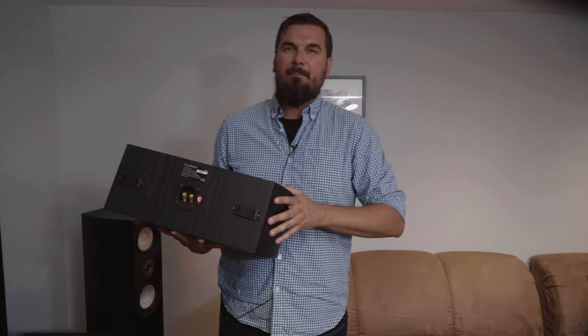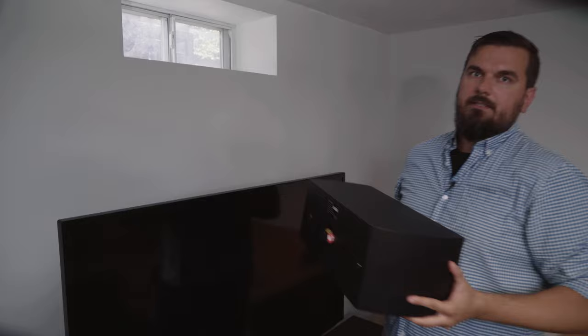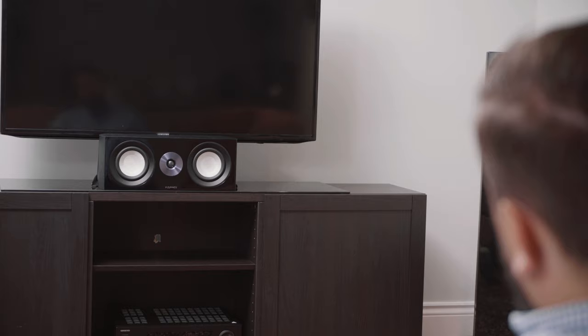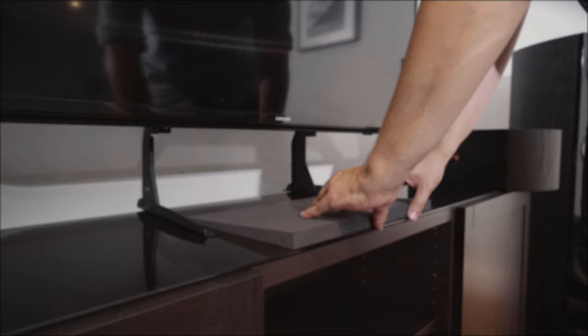The center channel has built-in speaker mounts, or you can attach an articulating speaker mount and angle it downward from above, or place it directly on your cabinet — just make sure it's not blocking your TV. Avoid putting speakers inside cabinets where possible, as that can cause resonance issues. It's not ideal and you may have sound challenges. Also, make sure the tweeter is aimed directly at the viewer; you can add angled foam to angle it up toward ear level if needed.